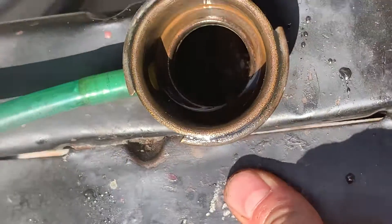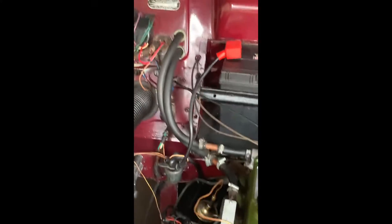There is quite a bit of nasty looking crud in there — definitely worth flushing out. I'll go over to the drain and get the hosepipe and do that. I'm wondering what happens if I actually open the heater valve — yes, I get a little bit more coming out, which is all the stuff coming out of the heater matrix.